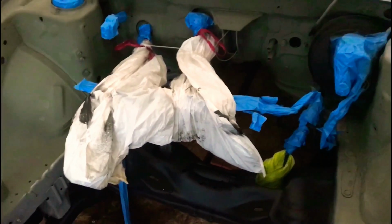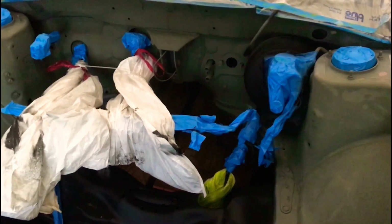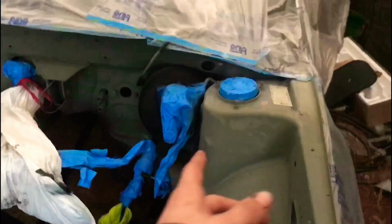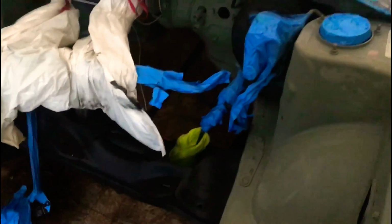And after I throw the filler primer on, I'll sand it, see if there's any more pits that I have to take care of. And if there is, I'll have to throw another coat of filler primer on. But if there isn't, then we can start laying color. So I'm really excited about that. I don't really have too much more to mask off. Obviously I have to mask off the brake booster, but that's really it. So here goes nothing. Wish me luck.